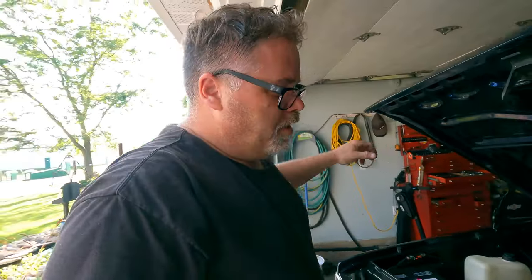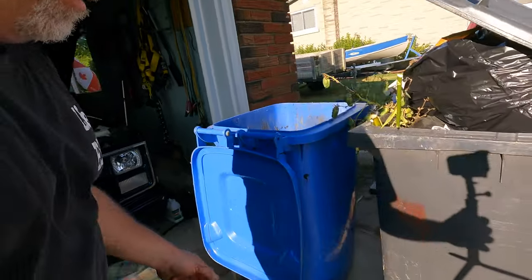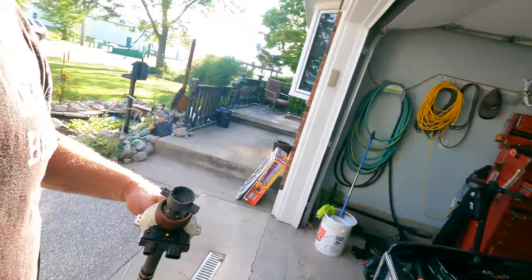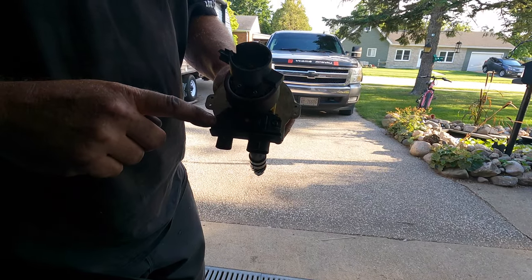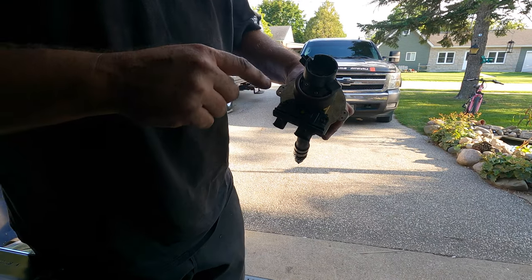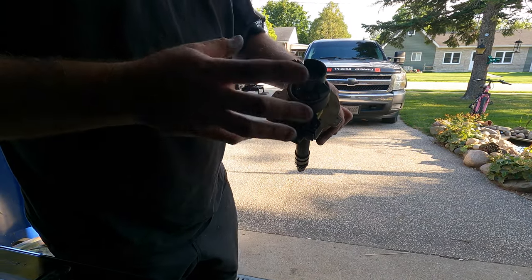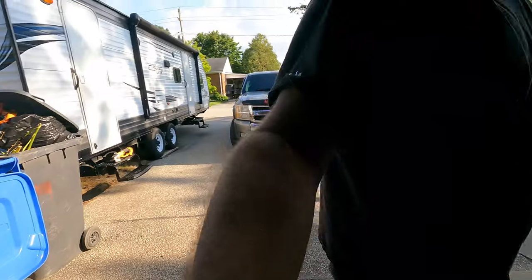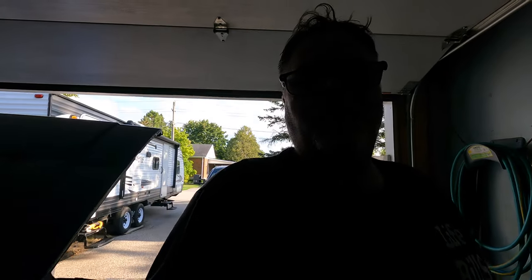Well, there you go. You have an old truck, doesn't start, you don't get spark or fuel, it's probably that little doodad in the distributor. Where is the distributor? Right here. Probably that doodad right there. I think it's called the reluctor or something. But that's $95 by itself, and the whole thing was $95, so you might as well just change it out. But we'll hold on to this one, because you never know, we might need some parts for something else.